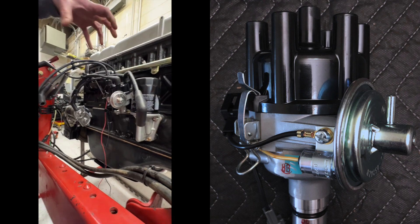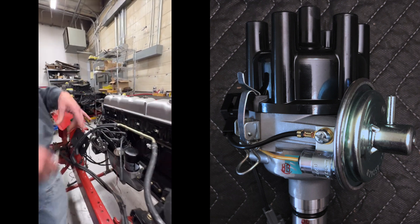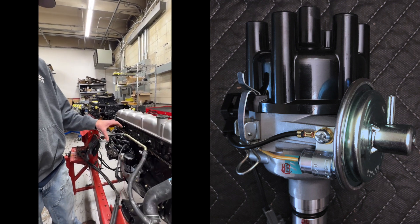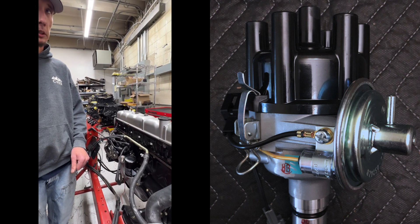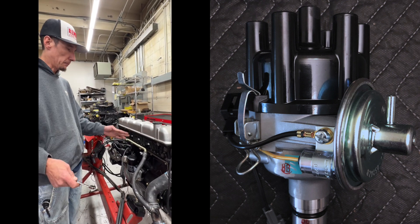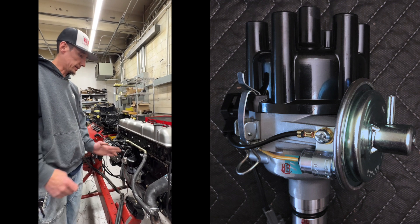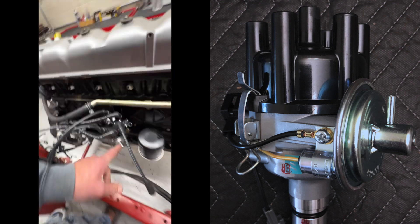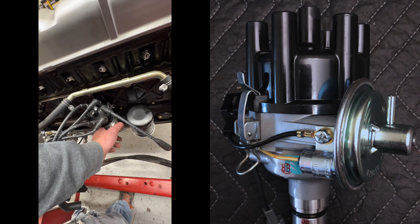Get your timing close, tighten the clamp, check it again. If you need just a little bit more, loosen it — but do not over-tighten. It doesn't take much to start stretching that bolt. You can leave it kind of tight, start the truck, and this distributor is not going to slap with the motor rotation on the cam gear. Advancing the timing is this direction — counterclockwise is advancing. This direction is retarding the timing.